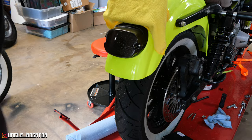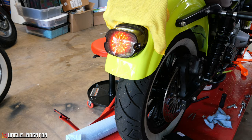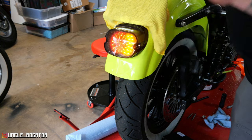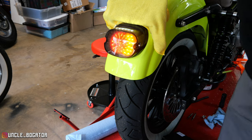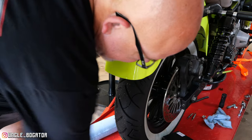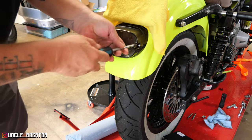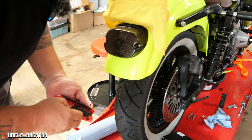What I want to show you first is this — somebody did put an LED on here, could be very similar to what Eagle Lights sent me. What happens is when you turn the turn signal on, it's solid, not flashing. What that indicates is that it needs a load equalizer. I've done load equalizers in the past but they were a very manual process — building diodes and whatever — so this one we're gonna hope works out.